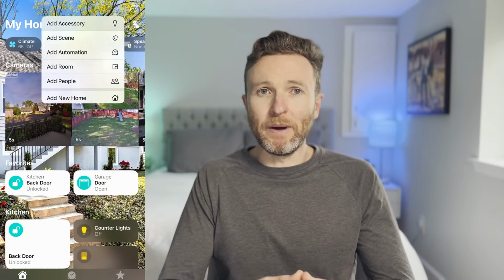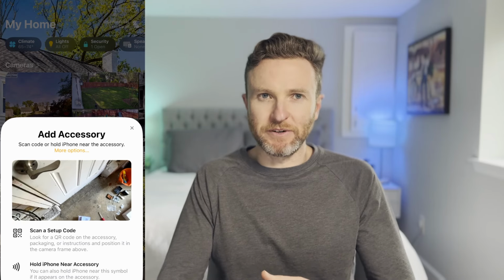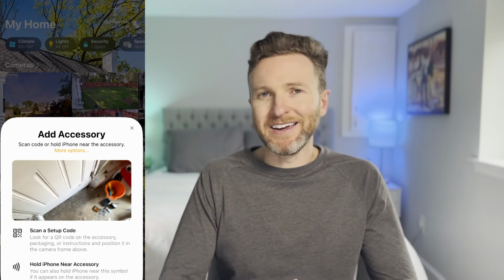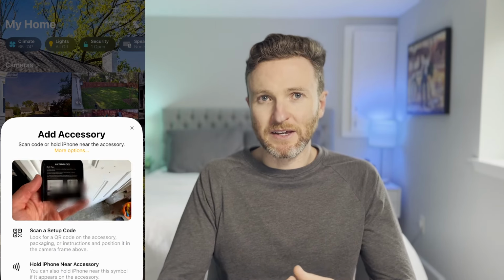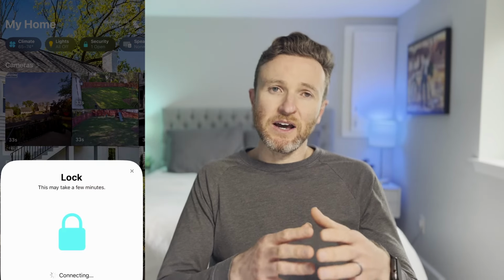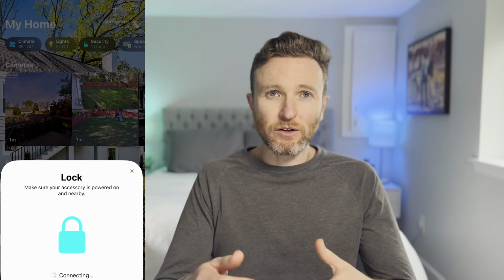Open the Apple Home app on your iPhone and click the plus sign and select Add Accessory. Scan the setup code on the inside of the battery cover and not the fake setup code on the included manual like I did. However, you must do all this within 10 minutes of first setting up your lock. Otherwise, you'll get a spinning connecting wheel for a solid 2 minutes, and it will then fail and tell you the accessory cannot be found.